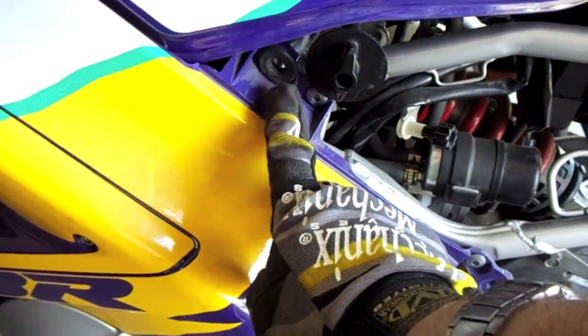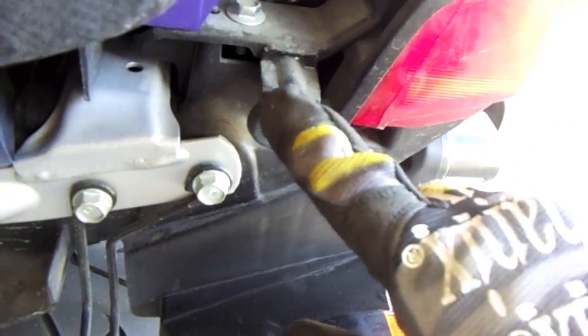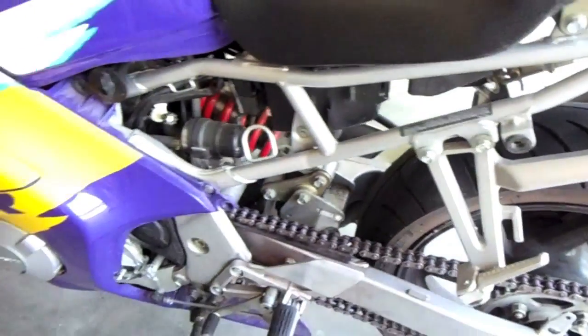There's the plugs. Just showing them again. Just pointing them out on this side. Again, just be careful when you're pulling those out. And it's the same thing on the back here. It's got a pin. And these little snaps here, just kind of push it down and you kind of pull the bottom towards you as you rotate it out, as you undo it from the rubber plugs.